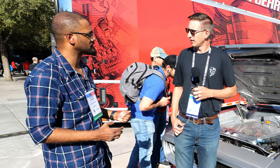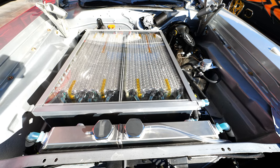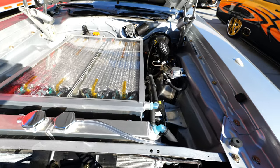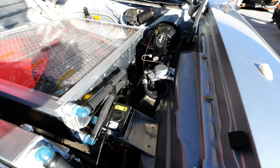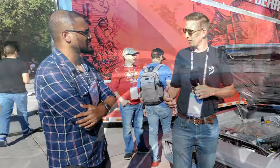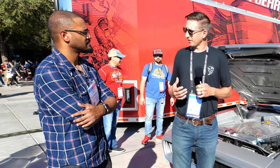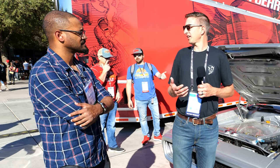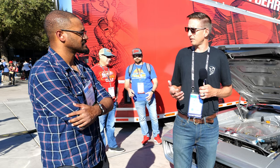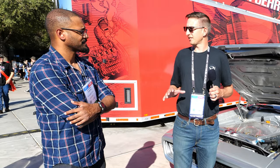As for the operating system: the batteries have thermal management plus battery management, handling amperage and voltage to keep them healthy — that's a standalone computer I monitor on a tablet in the dash. On the motor side, a CAN bus intermediate box communicates with the Tesla motor and makes it usable outside of a Tesla. Really all I took from the Tesla was their inverter tuning, which is spot on. Everything else is aftermarket.